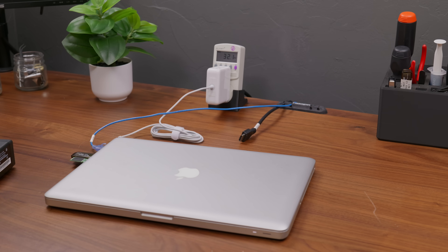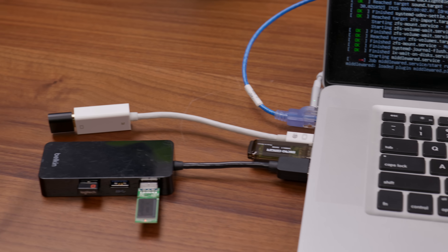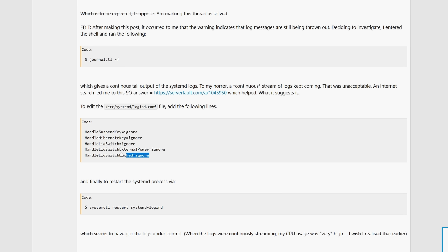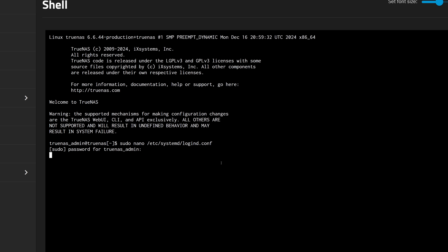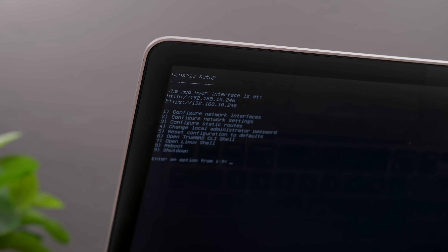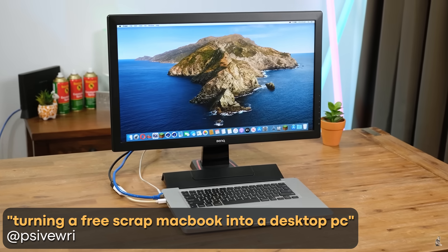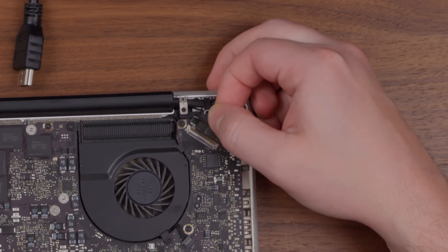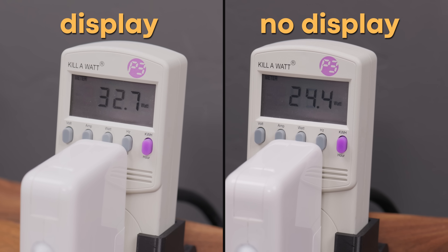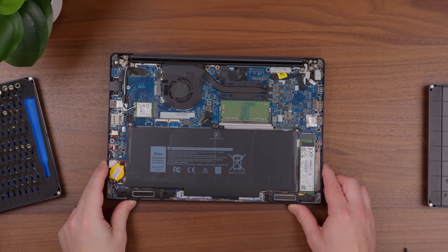Until I tried closing the lid — which caused the system to go to sleep and then crash. My first thought was to plug in a keyboard, mouse, and HDMI dummy plug to get clamshell mode like macOS, but that didn't work. Poking around online, I found a solution: make some tweaks to the logind.conf file to ignore the lid switch. That kept the system from sleeping, but the screen was still on wasting power. I found some potential solutions for turning off the backlight, but after seeing videos of people repurposing these MacBooks without a screen at all, I decided to just unplug the display connector entirely. Without a display, the system still booted into TrueNAS but was now consuming quite a bit less power, idling at just 25 watts compared to around 33 watts.